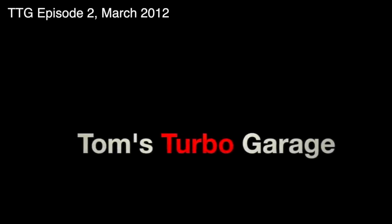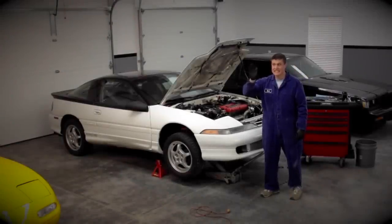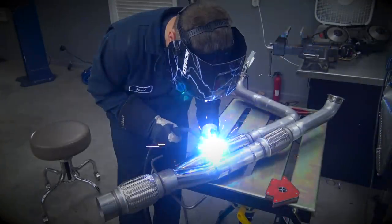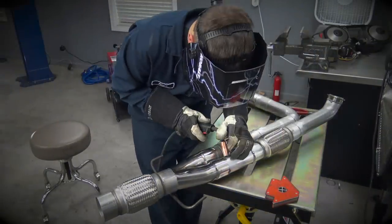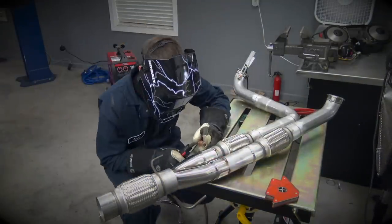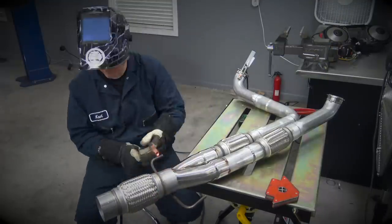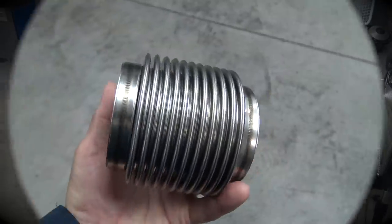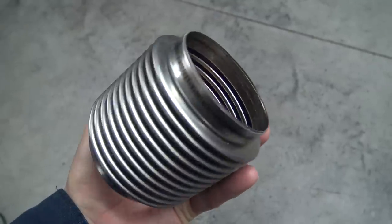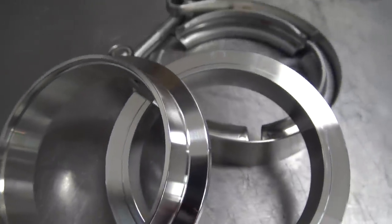Part of the fun of sharing my car hobby on YouTube is the support, motivation, tips, stories, and roasts you all share in the comments. A few episodes ago you saw me fab up the exhaust system to feed our turbo. A bunch of you advised me to watch out for flex couplings unraveling and ending up in my turbine inlet. I did a little research and yes, it's a thing that can happen, and I definitely don't want any of that. Even though I used high quality flex sections, you guys know your stuff, so I replaced those flex sections with Summit Racing exhaust bellows which allow for good flexibility without the chance of wire mesh unraveling or blowing out. I also added an interlocking 3-inch V-band to make removing the front half of the exhaust easier in the future. Thank you for the heads up, everyone.